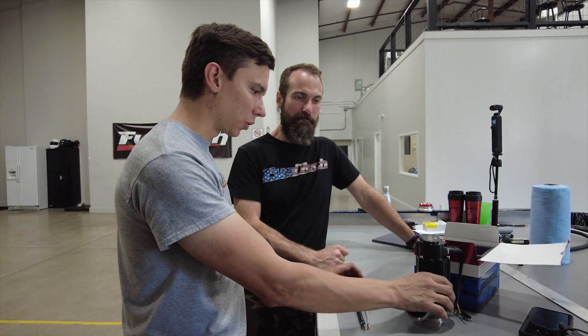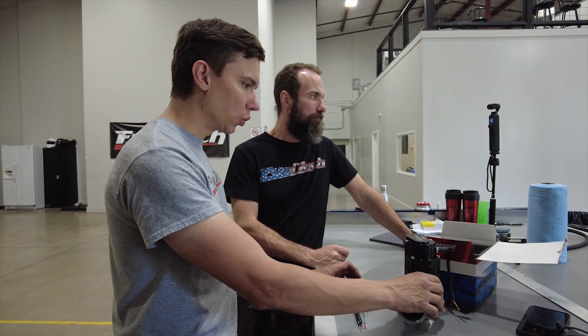On dual wastegate operation, you can electronically set an offset between them to equalize both sides of the engine — to make the back pressure the same on both sides. And you have the position sensor to confirm that. If you add a back pressure sensor, you can double or triple check that you're achieving equalization on the exhaust side.